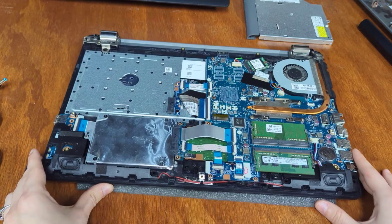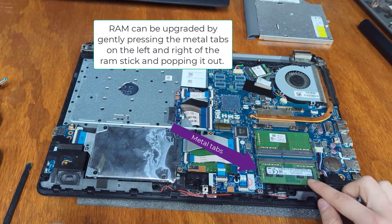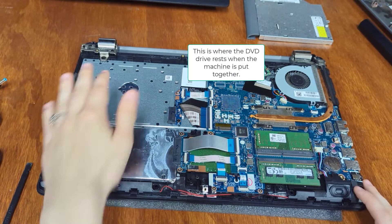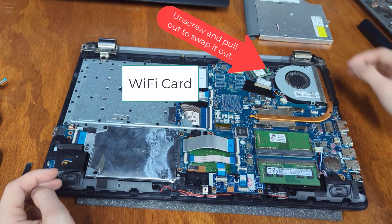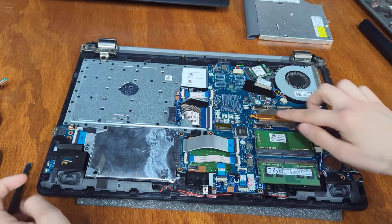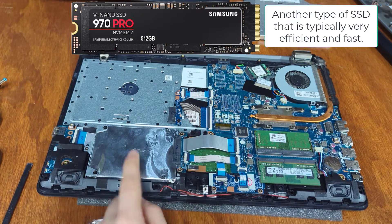Now the main goal for me today is to replace this conventional hard drive, right here, with an SSD or solid state drive. There's a number of different things you might want to get in here for, like the RAM sticks. You can also clean out the computer if there's any accumulated dust. A couple other things to know: this is the Wi-Fi card — if you remove the one silver screw, you're able to wiggle that out. The CMOS battery is right here, which you can pop out. The CPU is located right here underneath the heat sink. And this is a slot for an M.2 drive, which offers high performance. In this tutorial, we're going to use the normal 2.5 inch SSD.